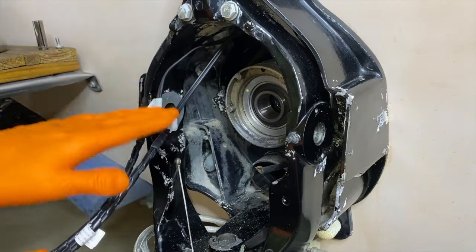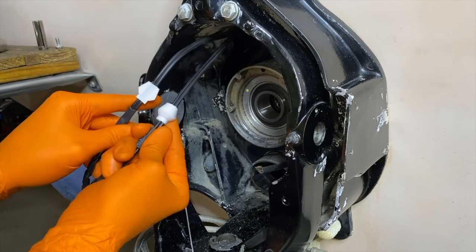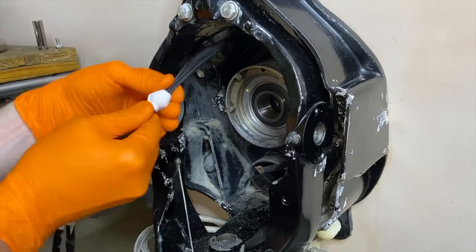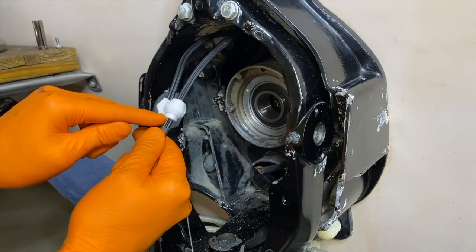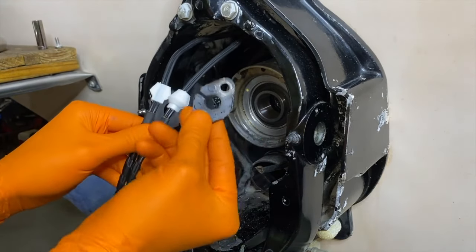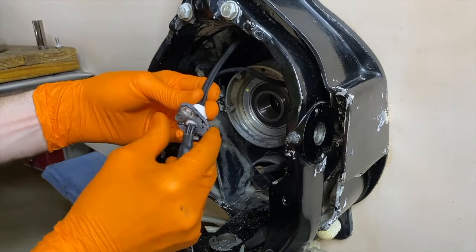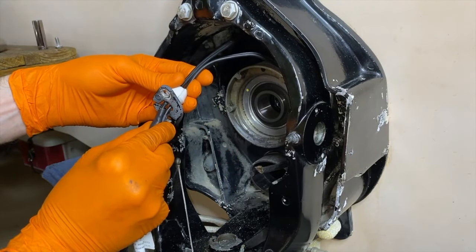We are now back outside the boat. With the new kit the halves are white instead of black. MerCruiser calls these halves — each wire has a half of this fitting, and when secured inside that hole it will create a watertight seal. There is a gap between each of the halves and the pre-installed protector — what is that for? To insert this clip. Make sure you insert it properly. Trim sender will go in first, trim limit will go in second, and once they're through, screwing it in tight creates that watertight seal.